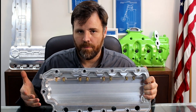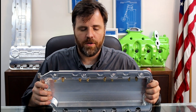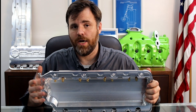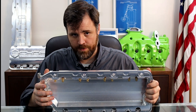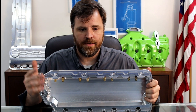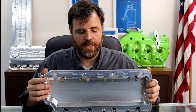That does dual purposes. First, we noticed that after we began to put oil through the valve cover on top of the rocker arms, it would muffle the engine down about 10 decibels at idle — which is pretty drastic, a huge audible difference. You can definitely tell when one of our valve covers is on any engine without even popping the hood, just because of how much quieter it is. The second benefit is that it obviously eliminates the factory issue of rocker arm failure, which can prevent serious engine damage.